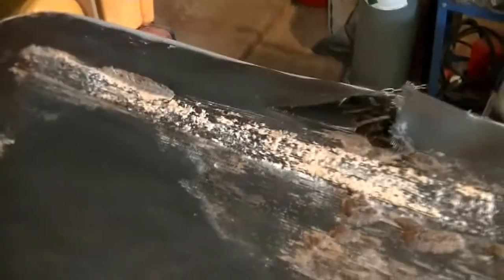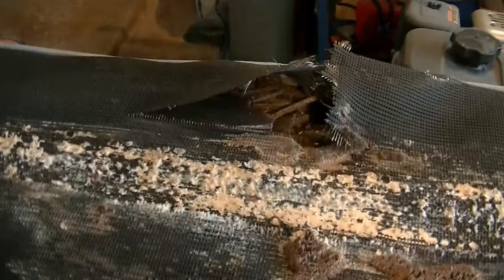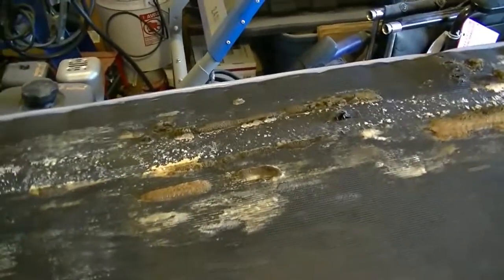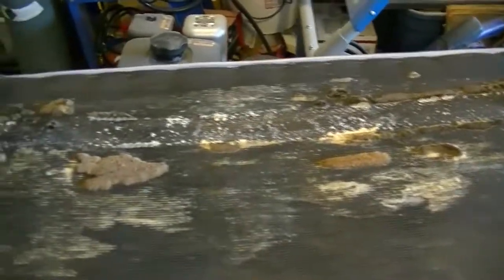You can see where it's pulled out. Even better is this one — you can see where the wood is totally rotten and there's a big bump here. There was a brace that went across here, basically held in with quarter-twenty bolts. They used stainless steel fasteners, however they used standard steel T-nuts. You can see where the holes are — there are two braces right across here.